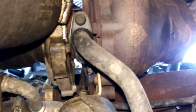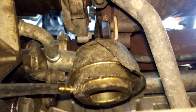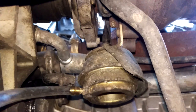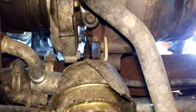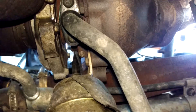Now dead centre of the picture, just there, is the arm. And so when I pull a vacuum, I'm looking for two things. I'm looking for the vacuum gauge to hold 20 inches of mercury, and I'm also looking for that arm to move around about 20mm at least. So I'm just going to now start pumping up the vacuum gauge, and we'll look out for that arm movement.